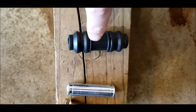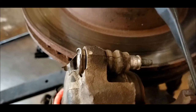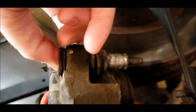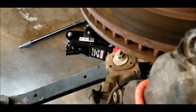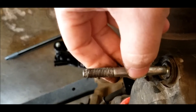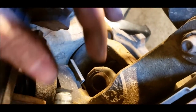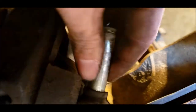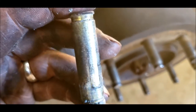I've got to get both of these out, then figure out how to put them in. I'm going to be using a mallet. Beating on it with a hammer actually went pretty easy - you can see it's starting to push through, and there's barely any grease on there, so that's not good. I can only get it this far, so now I'm going to put this bolt in backwards, because the head fits in there, and I'll hit on this end to push it out the rest of the way. This is what you end up with. I've got no grease at all on that one, and on this one there's actually a little bit of grease, but there's rust on it as well, and that rust was preventing it from sliding back and forth like it should.